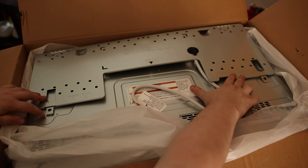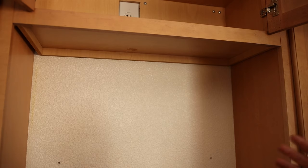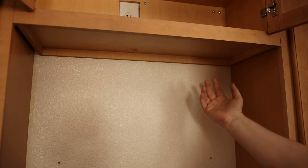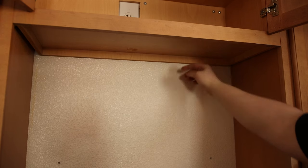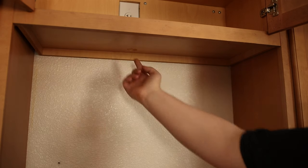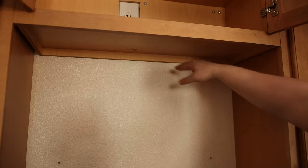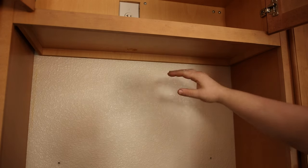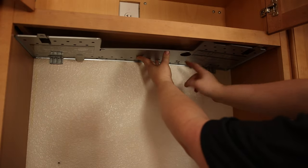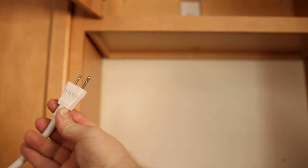You can see those line up with the mounting holes. We're gonna take this, press it underneath the cabinet, and mark out those three holes. In my particular cabinet, we already have a hole drilled for the previous microwave. The old microwave had the cord plugged in here, but because of this cavity they were able to run the cord across inside the cavity and poke it up through that hole to line up with the outlet above. Not all cabinets are gonna be like that — some will be flush like a shelf, some might not be deep enough. Normally you'd mark out the hole for the power cord and drill it out with something like a one and a half inch hole saw.